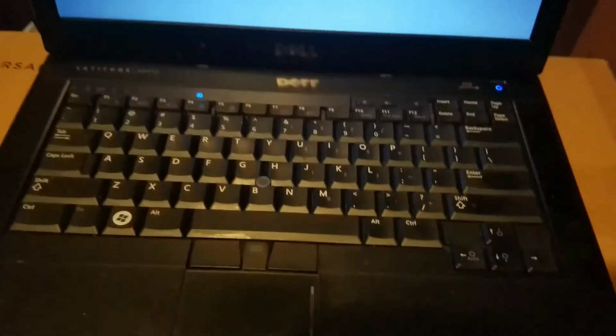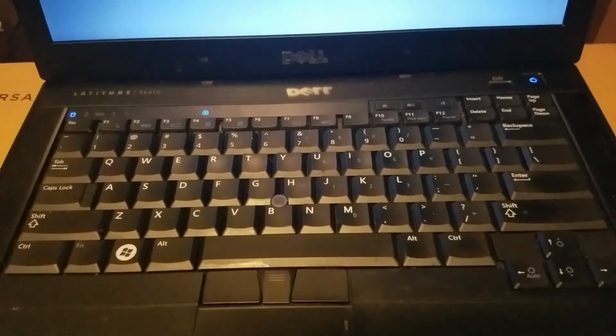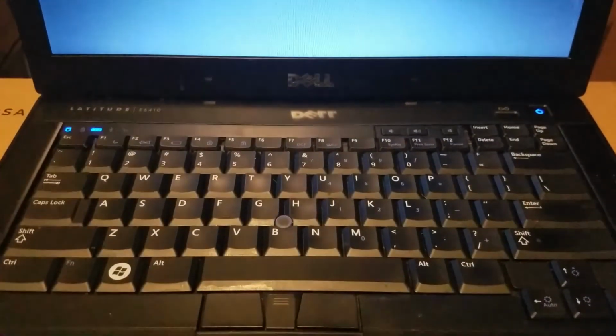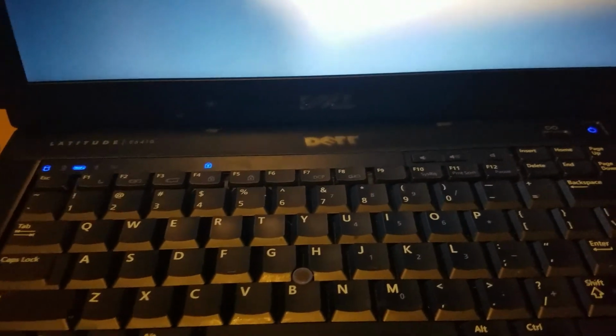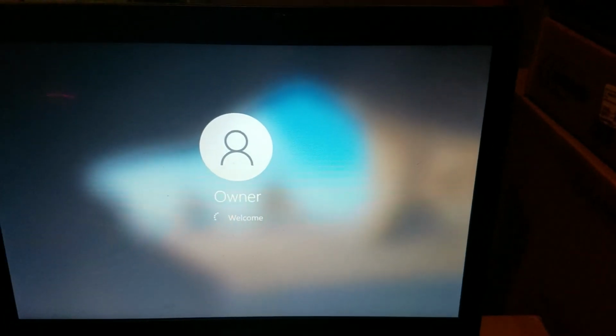But I also assumed that, while I do know that sometimes BIOSes can get sort of corrupted, and sometimes pulling the battery can be helpful, at this point I wasn't going to pull this machine apart to access the battery. I had assumed that maybe just using system defaults in the BIOS would have been good enough. And by doing that, it had caused other problems anyways. So some of this may have been user error, but I was just trying to follow some of the things that I had read on how to get that button to shut off after the machine shut down. Because, again, rather than going and pulling the BIOS battery out, I tried using default settings, and that didn't really help matters much at all. With that being said, after a little while, I managed to get it fixed.